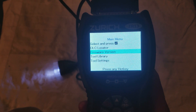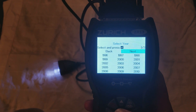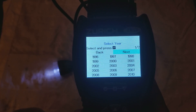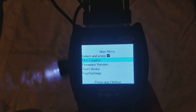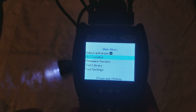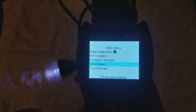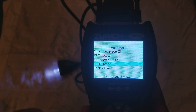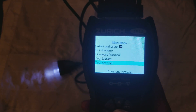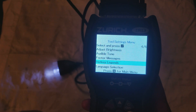The manual isn't very clear, but all the help is in the menus. It has a locator so for its entire database of 20 years of cars you can find the OBD2 connector — it'll show a general stick figure image of the dash with a blinking dot. You have tool icons which are like pages, telling you what the green lights at the top of the menu mean. The LED definitions for emissions and key help are in the tool settings, though the key help is a scroll while all other menus are done by pages.